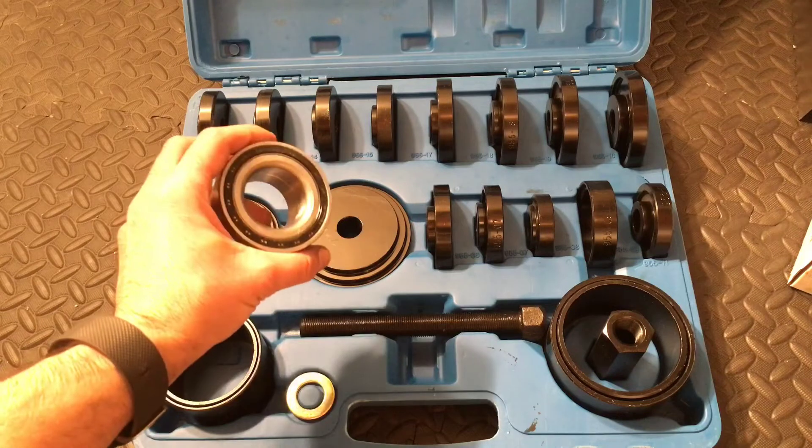What we have here is the steering knuckle, and you can see there's the old bearing — it's pressed in. We've already gone ahead and removed the actual retainer ring that locks it in place. If you want to see how to remove that, you can do so via the link above. The particular one used here was just a regular retainer ring, not an actual snap ring where you can use pliers to compress it and get it out.